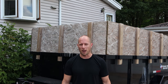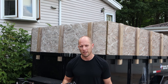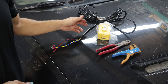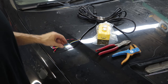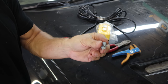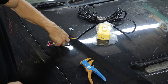Welcome back to our dump trailer rebuild project. The first part we got was our controller for our dump body, so let's hook it up and see if we bought a dump trailer or just a big box on wheels. Texas Pride wanted $130 for their dump controls, but I found one online for $25. The only difference is this one uses barrel terminals and our Texas Pride uses spade terminals, so we just have to switch them over.